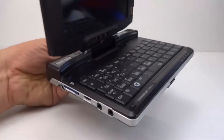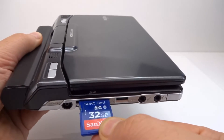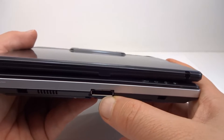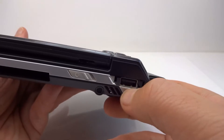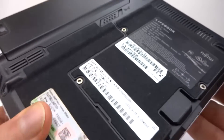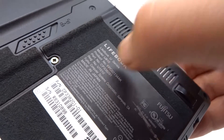We'll have a quick look around the unit. On the side here is a wireless on/off switch. We've got the power input, a full-sized SD card slot, a rocker for volume up and down, headphone and microphone, and this goes to the dock or accessory connector. We've got status lights, the main power switch, USB, and of course a compact flash card slot right in there. This machine was built for Windows Vista. It's known as the U810 mostly, but in some markets it's known as the U1010.